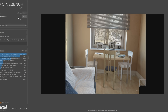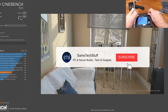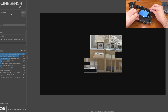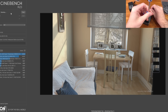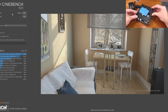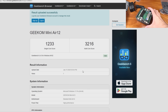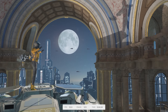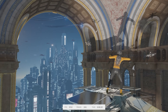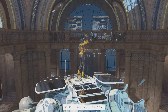Overall, the Air 12 is definitely a solid little mini PC that is not going to break the bank. Whether you want basic web browsing, a digital signage display, or a media server running Plex or Emby, this is the type of system to look at. The N150 is a very capable CPU and iGPU combination for media servers — you should be able to handle at least a couple of 4K transcodes simultaneously. Power efficiency is quite good: idle Windows 11 Pro sat at about 18-19 watts, and under Cinebench the meter never exceeded about 23 watts, which is really packing a punch per watt.